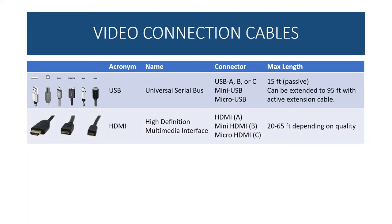HDMI is the most common cable by far among consumer-grade equipment, supporting 4K or 1080p video. Full-size HDMI-A is what you use to connect your big-screen TV at home. There's also mini HDMI and micro HDMI in smaller form factors. However, these cables really don't go more than 20 to 65 feet depending on quality, and at 50 feet or higher you're taking a chance. Remember these are digital cables — the signal either works or it doesn't, unlike analog cables that just add static.